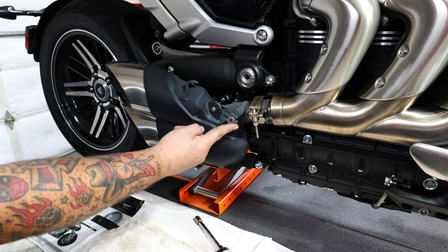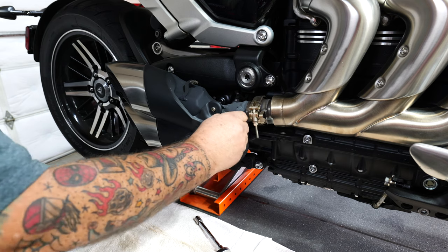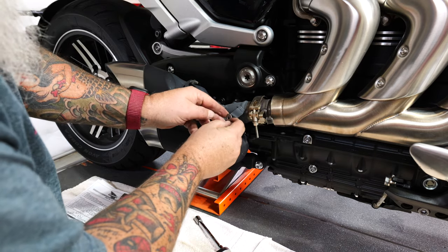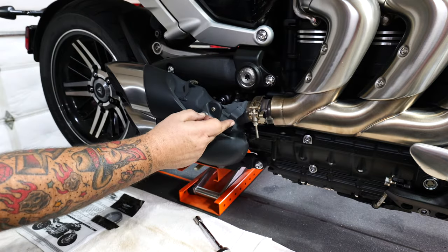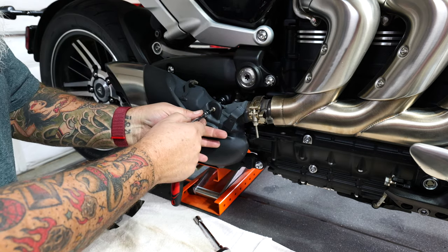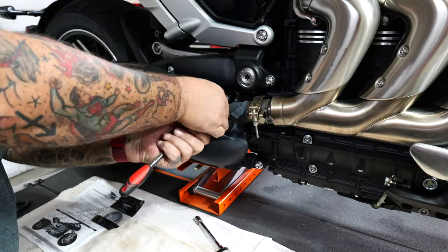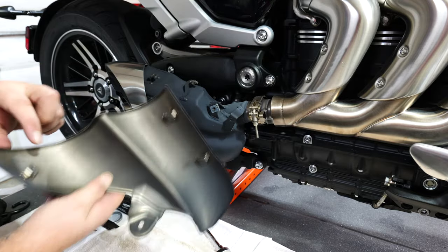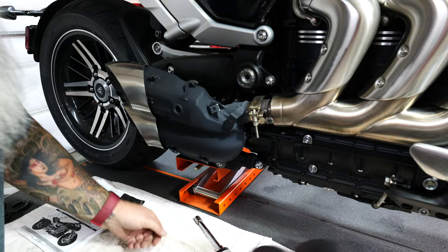This is the little nut plate right here that you're going to have to take off and put on the WORX pipes. You just got to kind of push that out and the washer — we'll save that because we're going to put that on the same kind of mounting point for the WORX pipes. Next thing you want to do is take off this little guy. That's a four millimeter. There are two little hooks here — the tab in there, and this one tabs in right there — so it just kind of slides in.